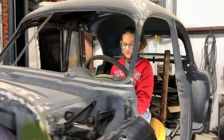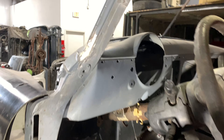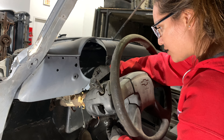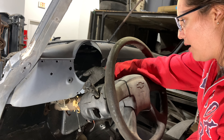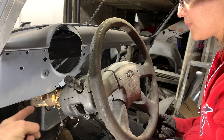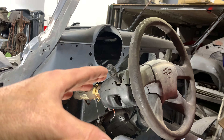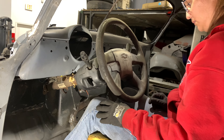Let's talk about the steering wheel. The shaft of the steering wheel has to be in line with the center of the divot, flush with it, and centered with your speedometer — so the whole column has to move up. The center axis of the column, where my finger is, is going to come up about two inches — so the whole steering wheel is going up. Let's see how close it is to your knees; that's about the middle position of up and down.